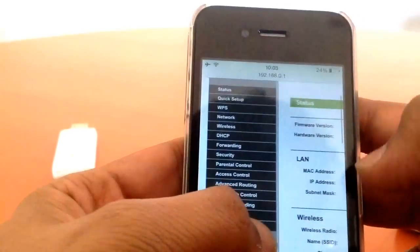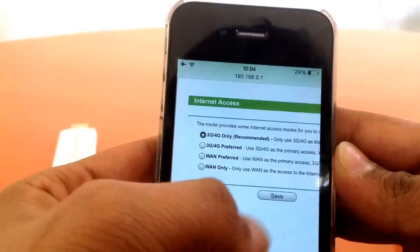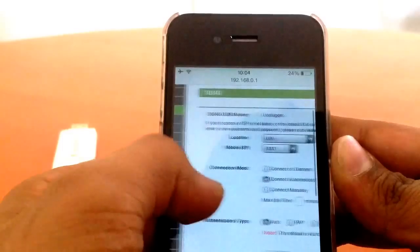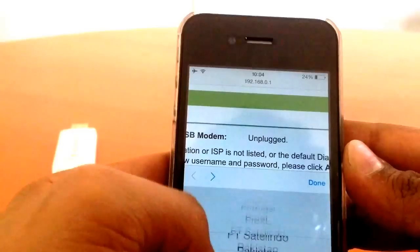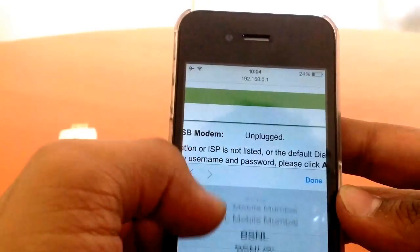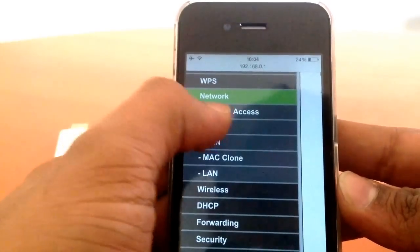You can see there are a couple of network options. Go to the Network tab and click on Network. Since we're trying to configure 3G/4G, keep the settings to 3G/4G only — you can change settings if you want. Click on the 3G/4G option. It will ask for a location and an ISP. Select your location — for my case, India. All compatible providers are listed there, but since our modem, the Pro 3, is not listed, we don't want to use the default options. Go back to 3G/4G.